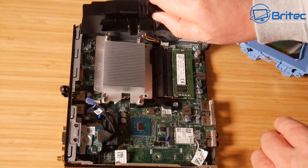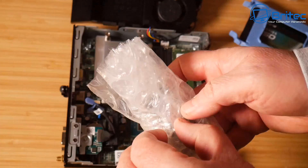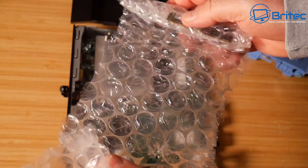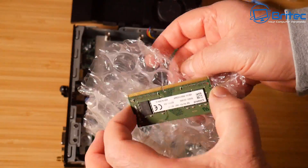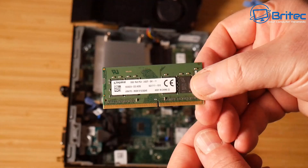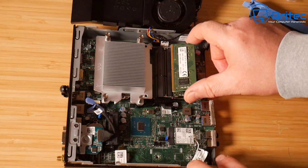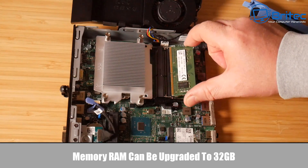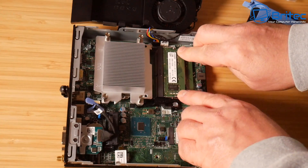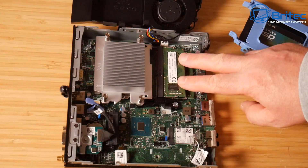Removing this cover exposes the CPU under the big heatsink. Here's the RAM — I picked up an identical pair on eBay for around £16 for 8GB, giving me 16GB in total. This system can accept up to 32GB of SODIMM DDR4 2133 or 2400MHz RAM — either will work fine. I like to keep a matched pair, but it's not strictly necessary. 16GB is good enough for what I need, though 32GB is an option.